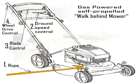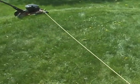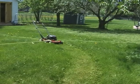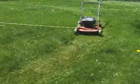Warning, tightening the number three blade control with a string as I did might be dangerous because in a case of an emergency, it will require longer to stop the mower than if it was held by hand. In my first trial, I realized that the diameter of the post had to be a bit bigger to be able to cut more grass per revolution.